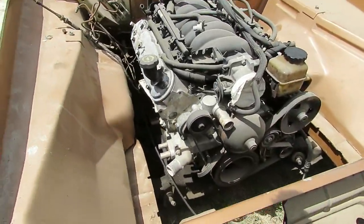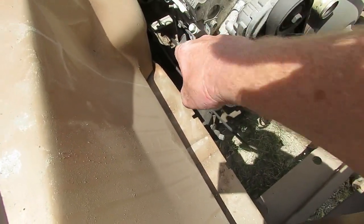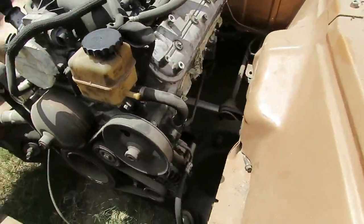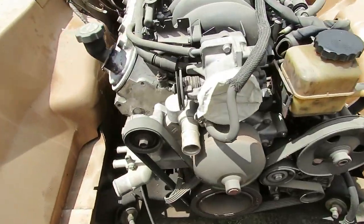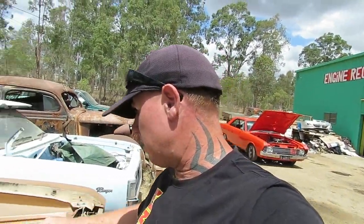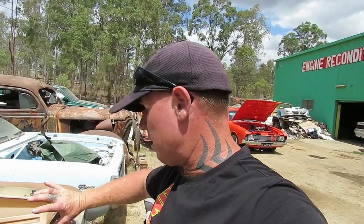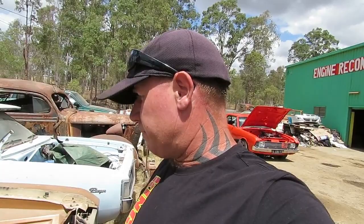Obviously you guys have spotted now that I've put an LS in this. The mounts that I got are from Castlemaine Rod Shop, which are already on there. This thing is bolted in and the gearbox is in. The only problem I've found with the mounts and the way it mounts to get it to sit right is your AC compressor can't sit down the bottom there anymore. And I want this car to be a daily for me, so it's definitely got to have air conditioning. So I'm going to have to buy a pulley relocation kit to run air conditioning and stuff still. But the LS does fit in there very well and it lines up really well at the back for the gearbox mount. I don't know, she's just a cool rig and it's going to be really nice.